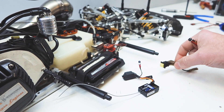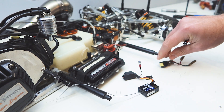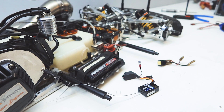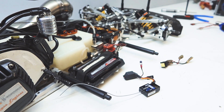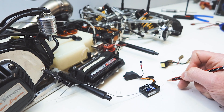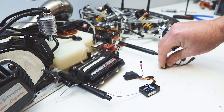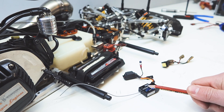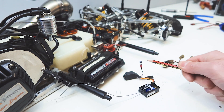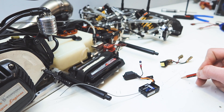A quick overview on how these work. The stock switch is normally open - that's described as a contact that's normally open. When we close the contact, the engine stops. So normally it's open; when we push the button it's closed, which closes that contact. The kill switches, without power, without the receiver turning them on, are normally closed. So you can see that without the transmitter turning this on, the engine won't start - it's just like having the button depressed. The connections are really simple: you need the signal going into your receiver - I've got mine on channel four - there's an LED indicator, and then two wires that simply get wired in parallel with the stock switch.